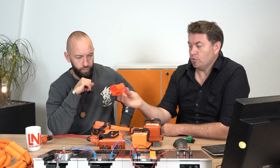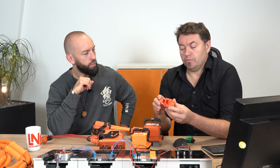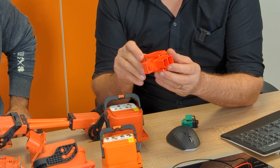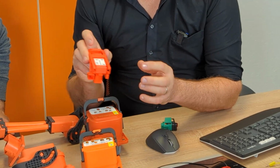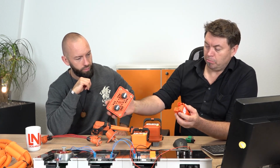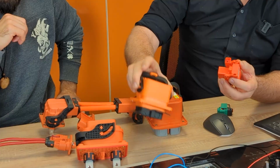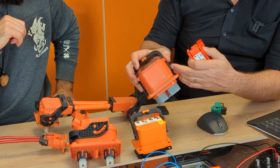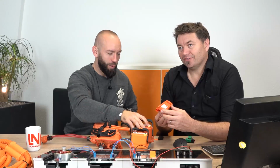Or as you mentioned, manual service disconnect. The manual service disconnect is the modern name for this. It started out being called a service disconnect. This is a typical example from the older ones that you see from Toyota, or Audi. This one is exactly from Audi. Some modern ones that you see here are a little bit different, a little bit bigger. This one, for example, is from a truck. This one here is actually called a mini manual service disconnect, even though it's quite big. And this one here is also for light vehicles, but it contains a large fuse. Even if it doesn't seem really light, it's a pretty tough guy.